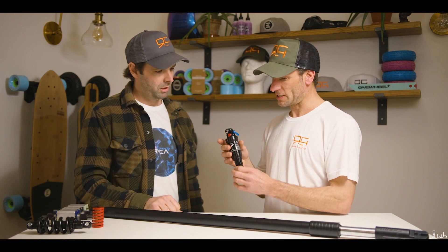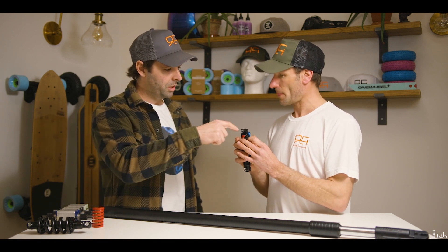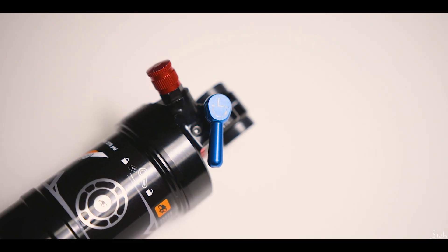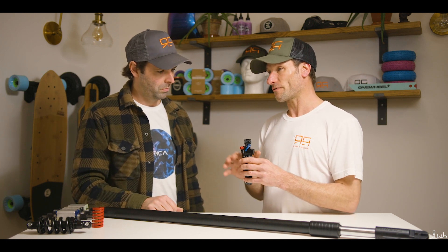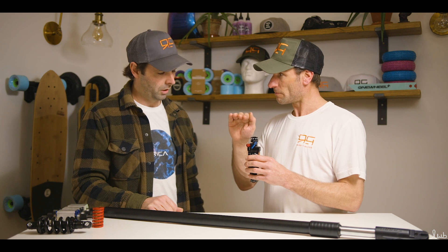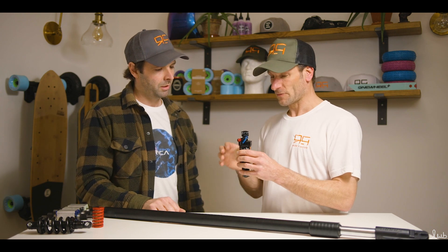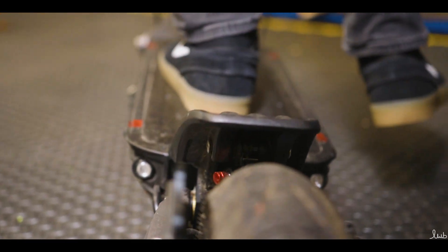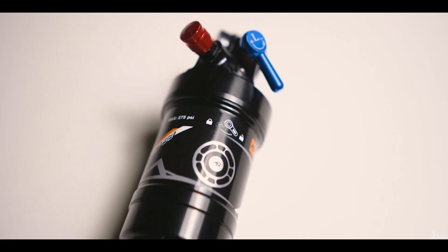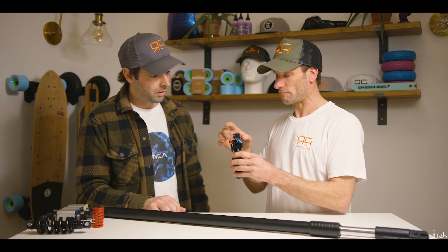This is a more technical suspension than the ones we've talked about so far — without a doubt this is the best way to go for suspension. This blue lever here is essentially a valve. It goes from lockout, which closes the valve and stops any movement inside the suspension. You'd use lockout to stop any bobbing when going uphill, so all the energy goes into the tire and you don't lose it through the suspension. Then you switch to trail or downhill mode when you're going fast or over big bumps and you need the suspension active. It's a quick easy way of clicking the switch rather than turning a dial.